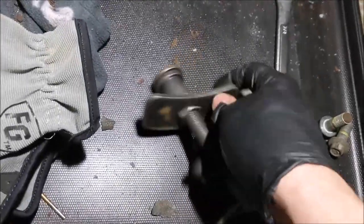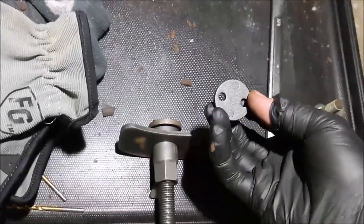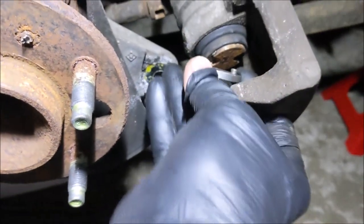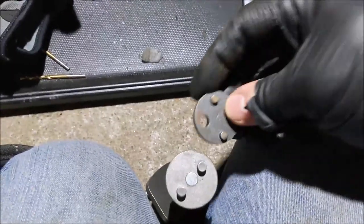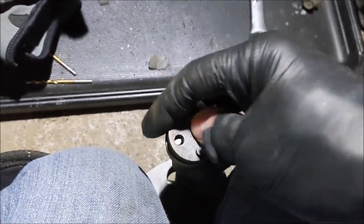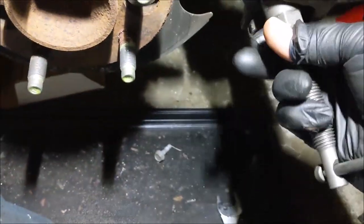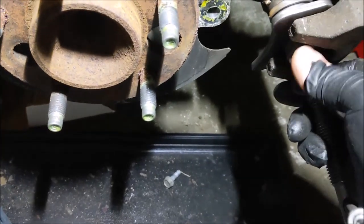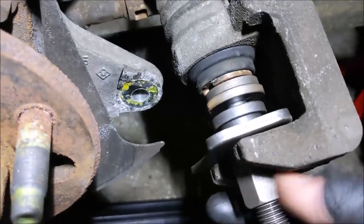You put this little thing on here, and there's a magnet. I went in my case and I found number 4, because the little teeth on there correspond with the piston. And this just literally sits on here. You line those two holes up. The magnet holds it. And then you get a 7/8 open end, essentially. I just line these up on here, and I wind this backwards.